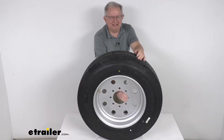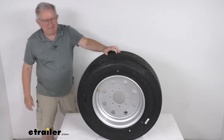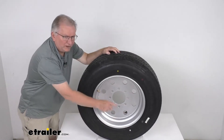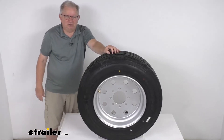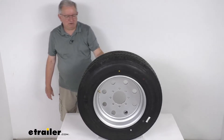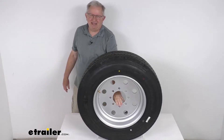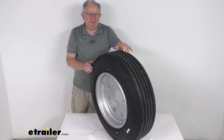The wheel itself is a heavy-duty steel wheel with a modular design — that's the one that has round holes all the way around the wheel. It is very sturdy and corrosion resistant. The wheel goes through a three-step finishing process: first a zinc phosphate bath, then an eco primer, and then a silver powder coat on both sides of the wheel.